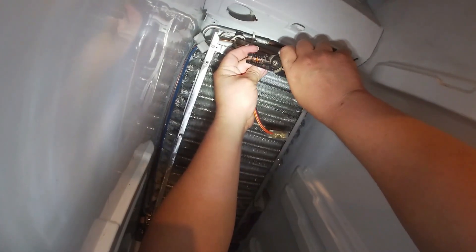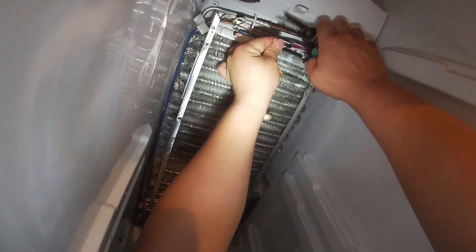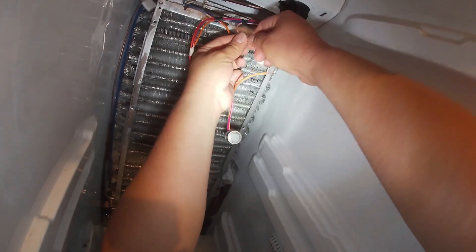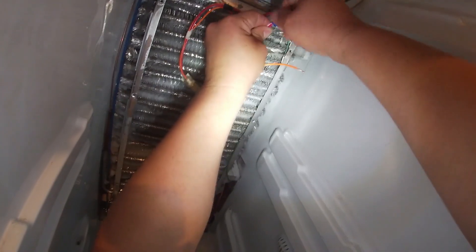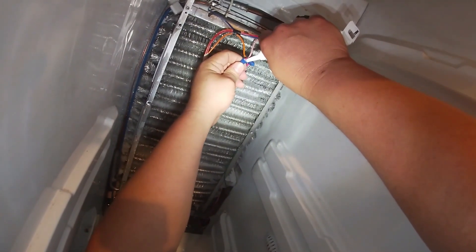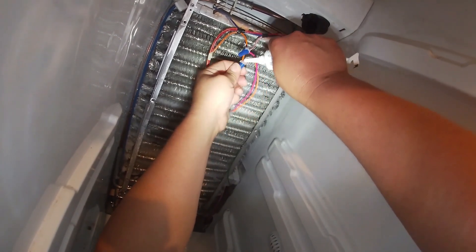The part comes with wire connectors in the back, but I prefer to use wire nuts because I believe they grip the wire better — that's your choice. Now we're installing the defrost thermostat. This defrost thermostat tested okay as well, but this refrigerator is about 12 to 15 years old and those are some of the most common issues with this GE refrigerator, so we're replacing it as preventative maintenance. We just didn't happen to have the defrost heater, so the customer made another appointment for that.